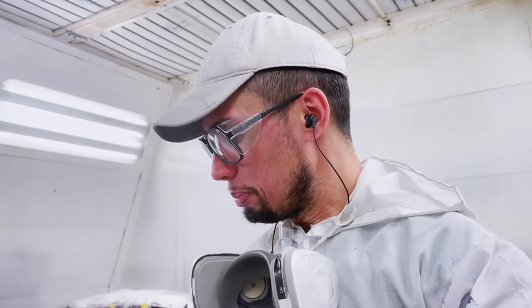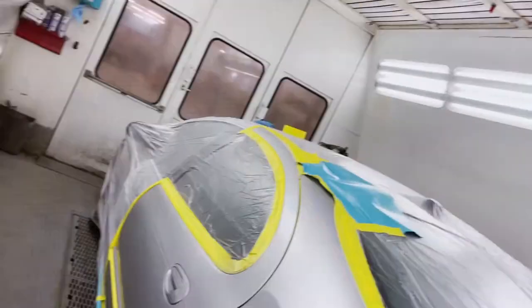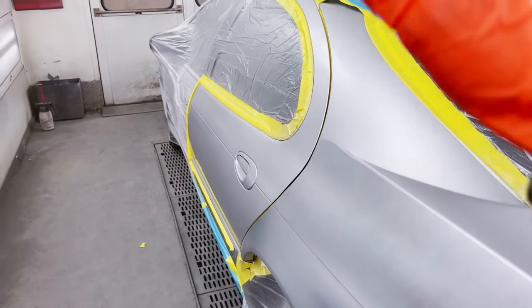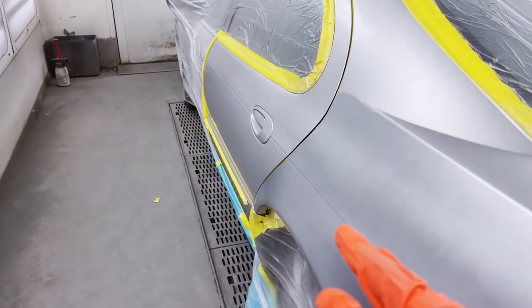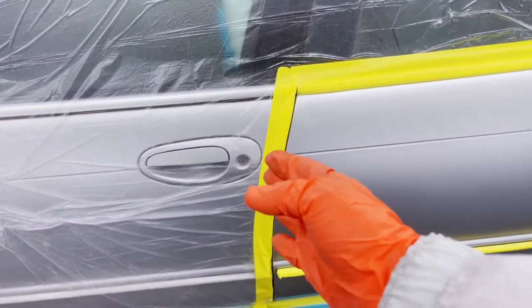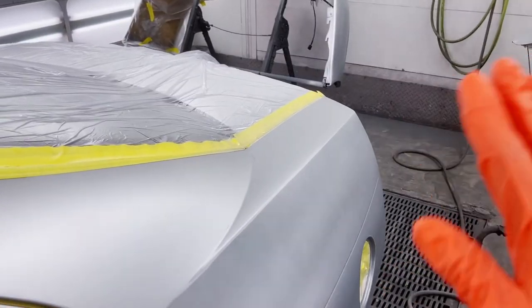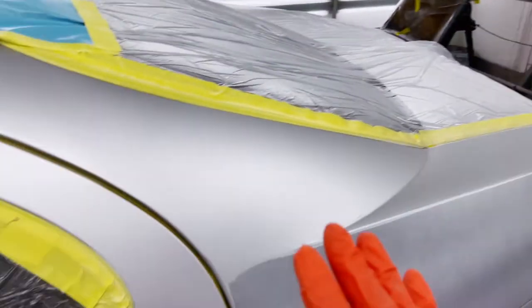I'm going to explain why I'm not painting the trunk lid — it's because the color is not different enough that it affects the transition onto the trunk lid, which is the trunk. I almost try not to do it just to avoid extra work because it's almost nearly impossible to tell the difference in the color. But when you're looking down the side of a car, especially when it's outside, you will definitely see a difference between these two panels not matching. So that's why I always tend to blend in these areas. But the trunk — you'll basically almost never see that difference in color, especially outside, especially with a color like so.